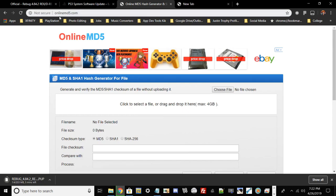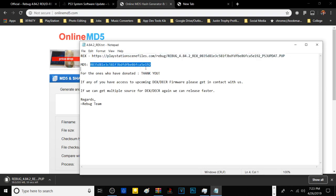When you update on a custom firmware PlayStation 3 there are certain things you need to do. First, make sure your Wi-Fi has been disconnected from your PlayStation 3. Make sure that you have no disc in your PS3. Also, once you do that, make sure you do the MD5 hash check. The Rebug team has left a hash in the txt file — this verifies the file is not corrupt and is the actual file it claims to be. Back in the day there were fake update files circulating that would brick your PlayStation 3, so always verify and safely eject your USBs.